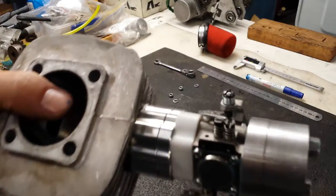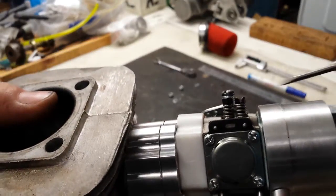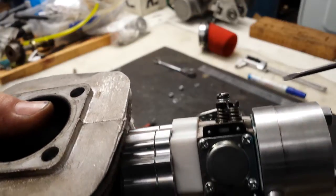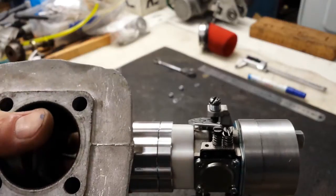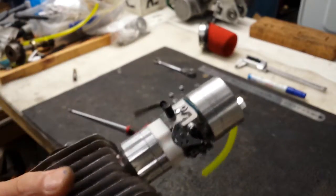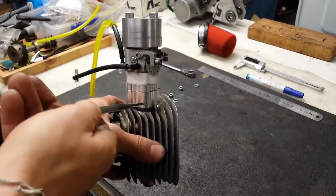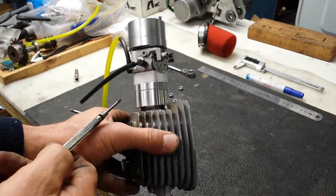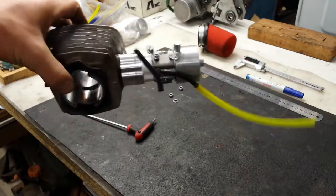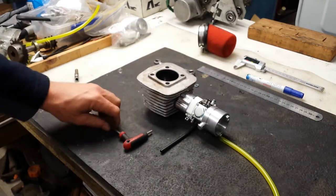The big benefit with this type of carburetor is you have your high and low adjustment needles, so it's very easy to adjust your idle fuel mixture and your wide-open-throttle fuel mixture with these two mixture screws — same as on a chainsaw. You can see the velocity stack that you've created, with all of this air moving at speed and generating velocity. That's the completed unit — hope that's been of benefit. See you next time.